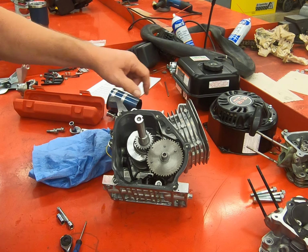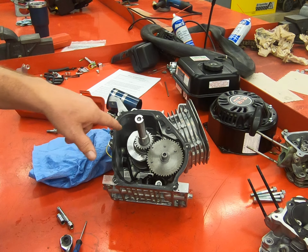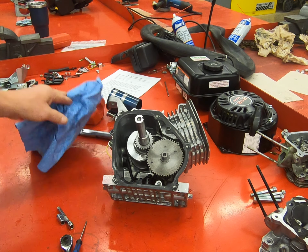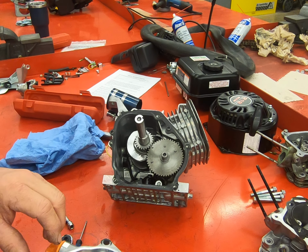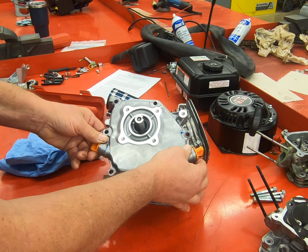However, we're missing a piece to our governor. There's a little cap that goes on there. It looks like a top hat. This one happens to be missing. Somebody had this apart before and lost that. We'll address that in the next video, but for right now, I'm going to show you how we put this cover back on carefully.